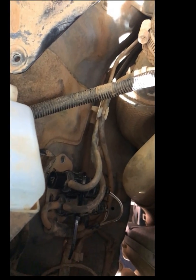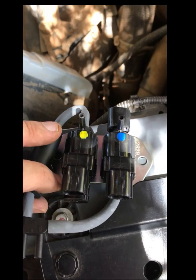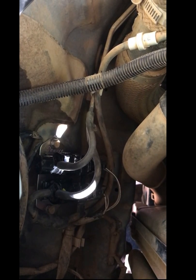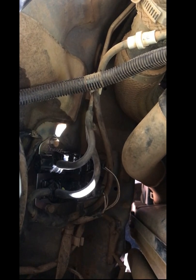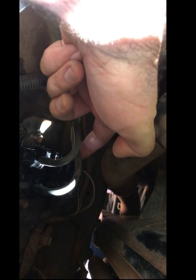The important thing is to remember where the hoses are attached, to get them the right way onto the right solenoid, and to unclip the power connectors at the back. Be aware there is a yellow dot and a blue dot signifying which solenoid is which. There's a metal spreader that separates the two tubes — the top tube comes up and goes into the blue solenoid, and the one underneath goes into the yellow.